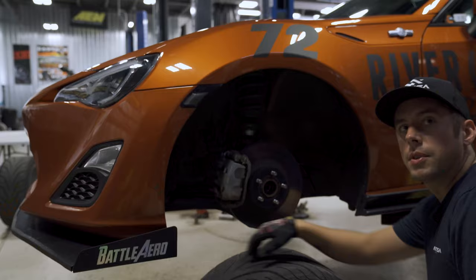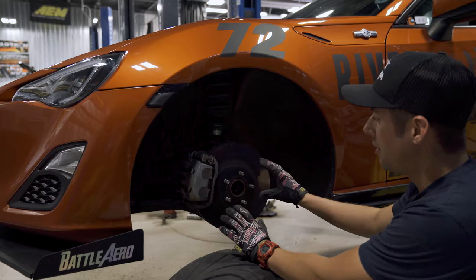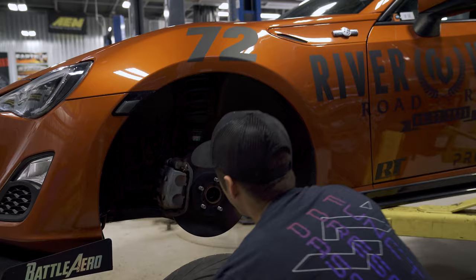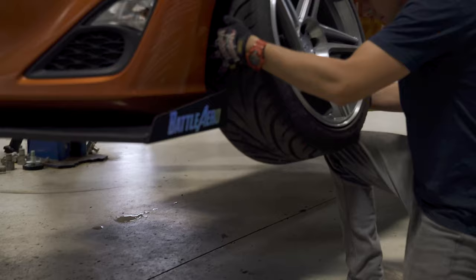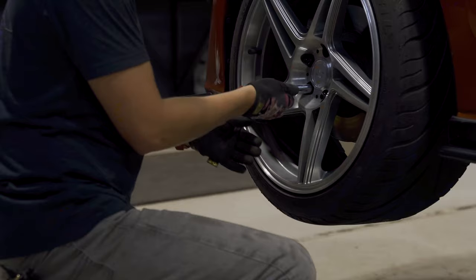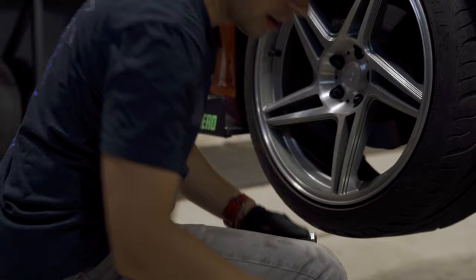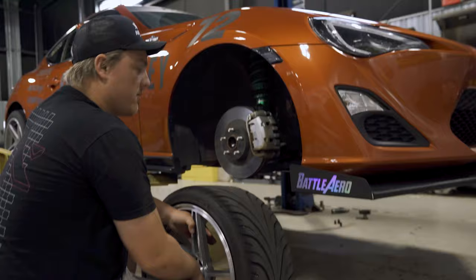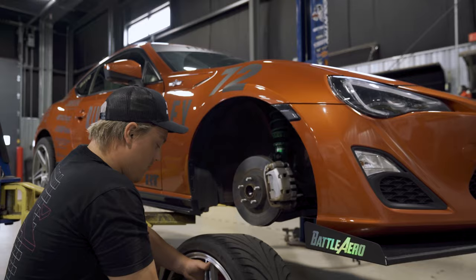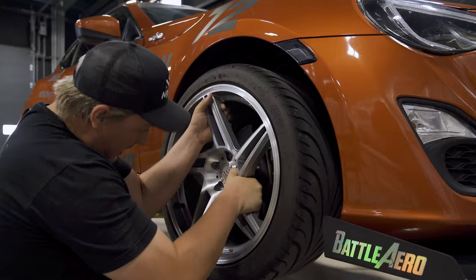We also sell suspension by the way. So when you're mounting your wheel, the best thing you want to do is get it lined up as you put it on there, versus putting it on and then trying to mess with it on the studs. You don't want to mess up the threading at all, and if you have your calipers painted, you don't want to scratch that up. Take the wheel, if you've got a lift like we do, use your knee, kind of angle it in and send it home. Then before you walk away, take your lug nut socket or key and just put one lug nut on for safety. Sam went ahead and did the driver side — the left side — so I'm going to do the passenger side, the right side. Left is going to be your driver, right is going to be your passenger.